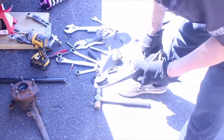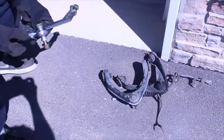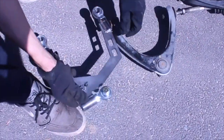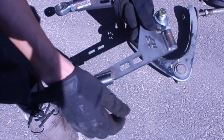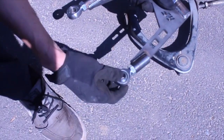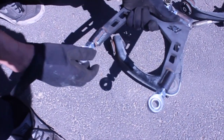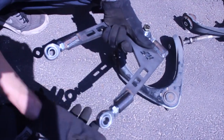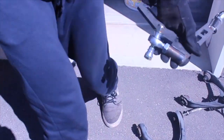Typically when you do that you want to leave the castle nut on, but I really don't care about this control arm — this one's shot anyway. Just for a quick comparison: the old one and the new one. It's longer. And the thing is, I'm not going to play with them much because I really don't want to increase my track width, so I'd rather keep them as short as possible. You can adjust these — if you extend them out and extend your lower control arms, as it is these add about 75 millimeters to your track width. You can add another few millimeters if you want.